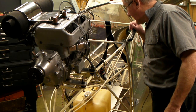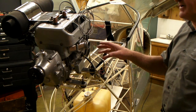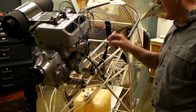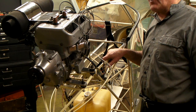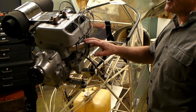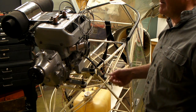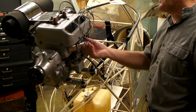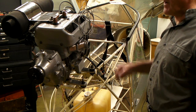I might put on an auxiliary tank too. I think I found out why the previous owner was having trouble — the EGT probes probably weren't working right, so he wasn't getting a hot enough EGT reading and kept leaning out the needle to the leanest position. He probably had it running too lean in the mid-range. The main jet was alright, but below full throttle the needle jet controls that, and the needle on the slide has to be in the right position.